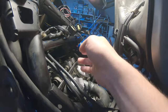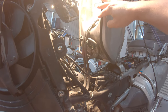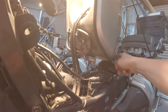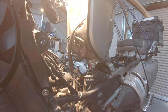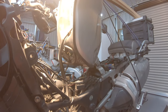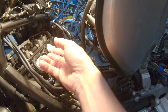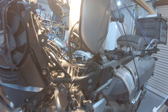I also realized now that I have to put back the valve cover that it would have been handy to remove the tank, because at the end of the day, there isn't much left to remove. You have to unscrew it from here. These pipes are easily lifted out. The petrol pipe here is disconnected anyway, so there are only two electrical connections, and it's straightforward to remove it actually. And that would make it much easier to slide in the cover and look underneath. But at this stage, I think I will do it without removing the tank.